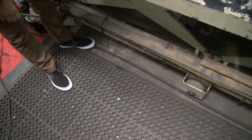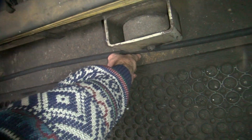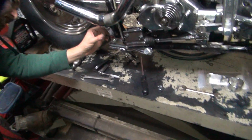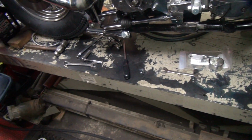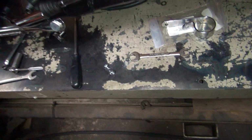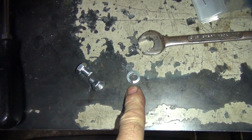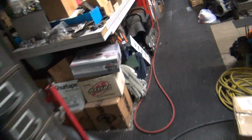Okay. See how quality bolts can't torque? So this is a genuine crappy bolt. Okay, do you know what torque you had on that? I don't. Did you think it was tight, or did you think it was still tightening? Yeah, it felt like it was still tightening. That's because it was breaking. Now we need a better bolt. Okay, now we gotta go get a real bolt. So, see what length that is? You notice how the washer is also gone away? Because you over torqued it. Junk hardware. Okay, let's go get some real bolts. Bring that with you. That's why I throw away most hardware that comes with parts, because of junk.